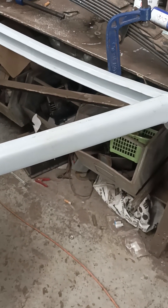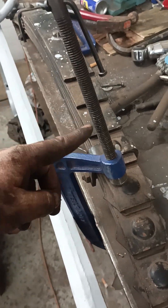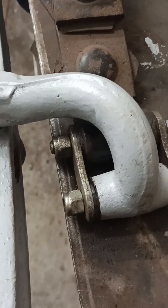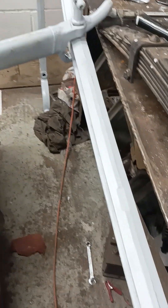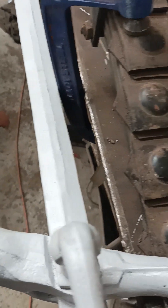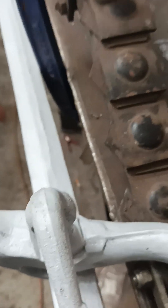Here's one for you. If you ever have to change the spring on an early Ford, put the spring on the bench and then you can clamp it with a G-clamp against the bench and squeeze it down enough to get the shackles in. This way you can do it on your own — you don't need a spring compressor or fancy tools. Just watch out if you're doing an original one, because you need 10 clamps.